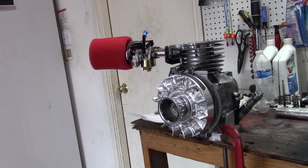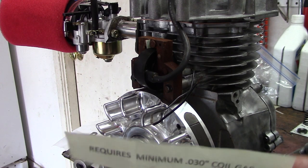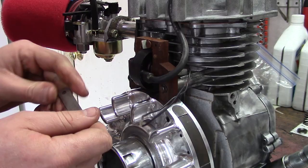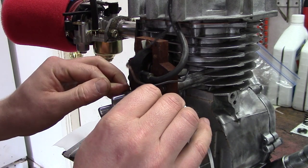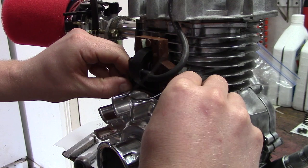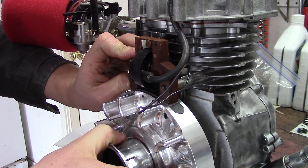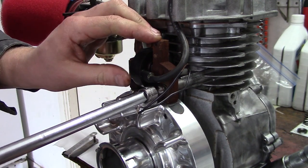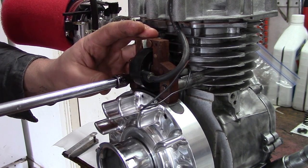That's pretty much it for installing the flywheel, but you do have to put everything back together. Taking the magneto, you torque that to your engine, and now I'll show you how to gap the flywheel. This is very important — if you don't gap your flywheel it can shut your engine down. You want to gap it to 0.030 inches. I doubled up my feeler gauges to reach 0.030 inches. Put them under there, then rotate your flywheel so the strong magnet holds it in place while you torque it down. The magnet does the job for you. Torque it to specs — usually about 6 foot-pounds. Do not over-torque those little bolts.